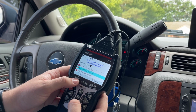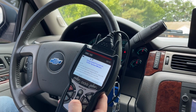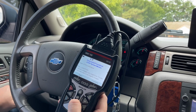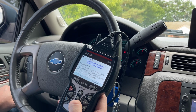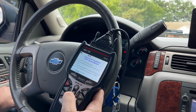And then let's go check for evap. One moment, please. Vehicles equipped with engine off natural vacuum diagnostic use the scan tool or equivalent to run the evap emissions control system monitors without the need for a cold soak. The evap monitor must be set to no, and there can be no codes, so you can't have codes. Yeah, exactly. Okay. And this says battery voltage can range from 11 to 18, engine coolant temperature less than 95 degrees, ambient and secondary air injection temperature, ignition must remain off. During the engine off, vehicle must remain at rest. Continue.